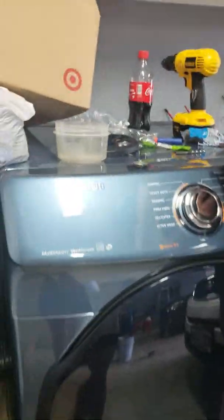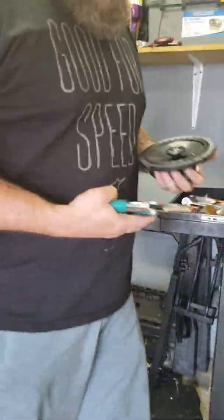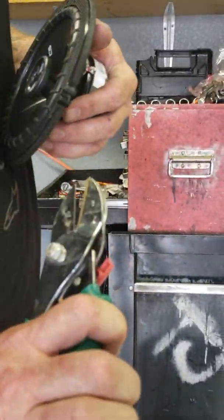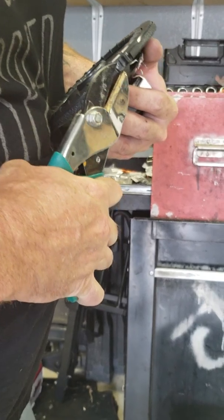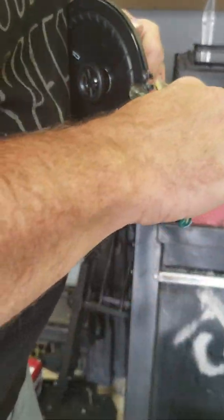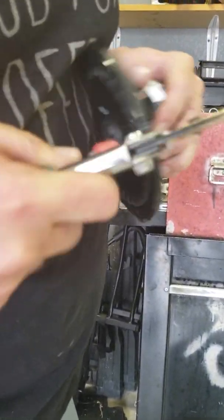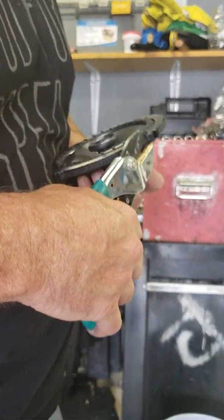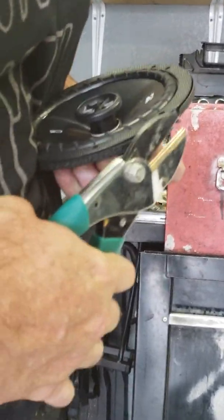Now over at my workbench - one other thing: you're going to need some cutting tools, like dikes. I'm actually just using gardening shears; they have a good flat side and a pointy side. These little tab nubs have to come off. Cut them off - most of the time they'll just pop. If you angle it and give it one more, you can get it to go down and bend them over. We're going to bend those tabs in so we get a nice clean circle all the way around the speaker.